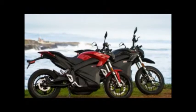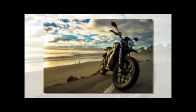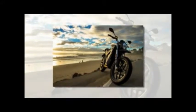Partnerships with Showa, J.Juan, Bosch and Pirelli first seen on 2015 models carry through to 2016, the DS receiving a fully adjustable 41mm inverted Showa fork and similarly adjustable Showa shock. Suspension travel is 7.0 inches front, 7.3 inches rear, to better cope with the light off-roading the DS was intended for. Pirelli MT60 tires wrap the 19-inch front and 17-inch rear cast wheels, a sign the DS isn't meant to be a hardcore off-roader.